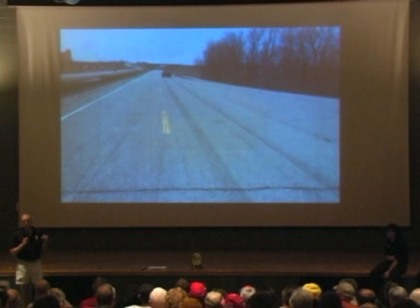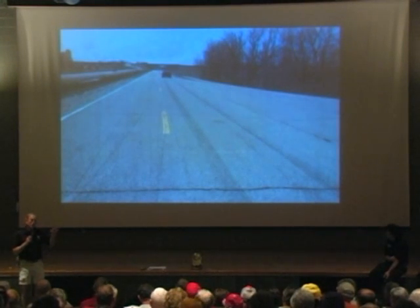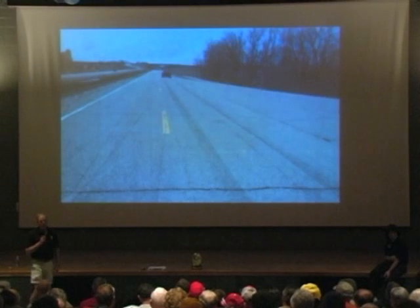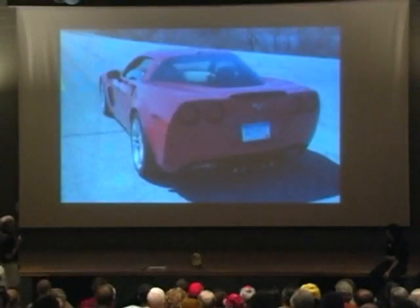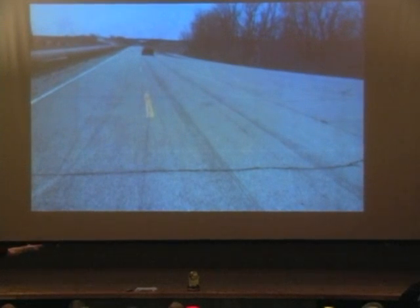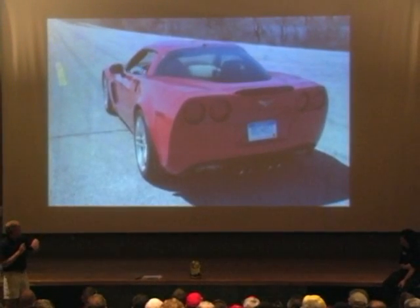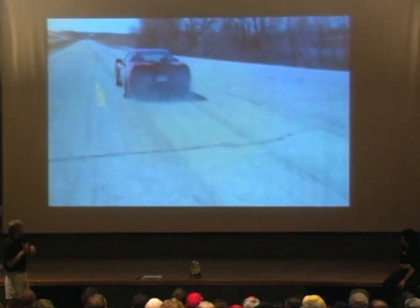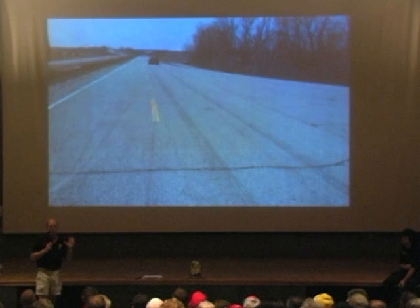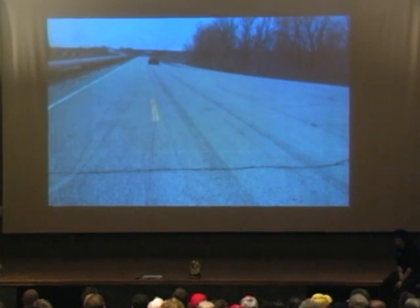That's Luke Sewell — he's the guy who does our performance times. That's him doing kind of an optimal launch. You can hear the wheels spin up and then they're just going a little bit faster than the car. It takes a while for them to hook up, and then it hooks up about when you've got peak torque, and then runs the zero to 60. This last video — that's just anybody with the system on. You can hear the engine come up; I think it came up to about 4,000 RPM. You get a little more wheel spin than the optimal, but you can hear the engine modulating the torque — it's got a little different character of sound — but it makes it work very close to Luke Sewell's best effort.